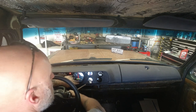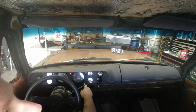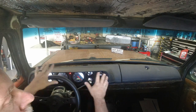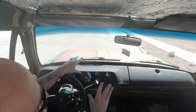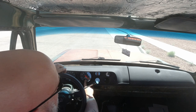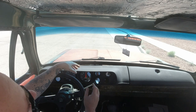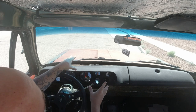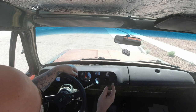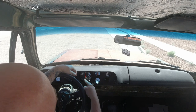So we have that button in. There — the speedometer went to full sweep. Now I can go and drive to the beginning of my two-mile course that I already scouted. Once you're at the beginning of your two-mile course, press this button on the speedometer one time and your speedometer should go to mid-range. Now you can drive your two miles. It doesn't matter how fast you go, it doesn't matter if you have to stop or make turns. All that matters is the accuracy of your two-mile course. You should see your trip counter quickly counting as you drive the two miles — all that's doing is counting the pulses.